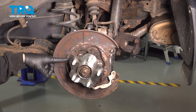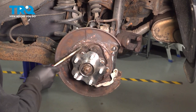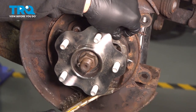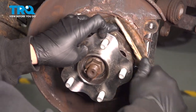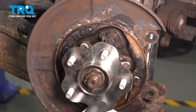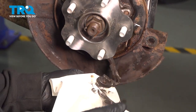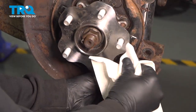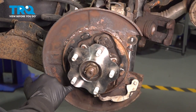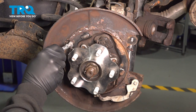On our backing plate, there are six contact points that our parking brake shoes make contact with. We're going to use our bristle brush and clean this here, clean the back with some solvent, and clean this bracket for our e-brake setup. On the six contact points, we're going to put a thin coat of grease — this will help eliminate some of the friction.